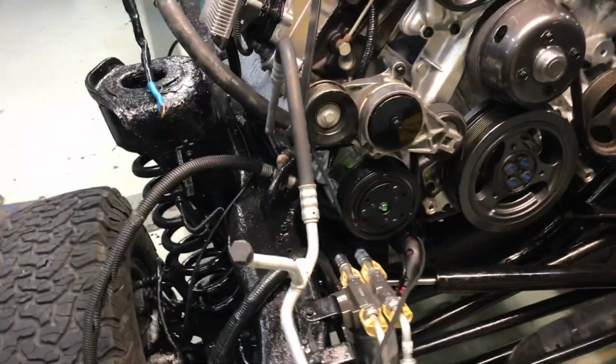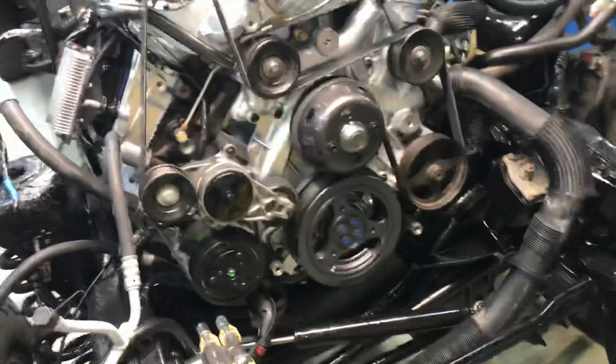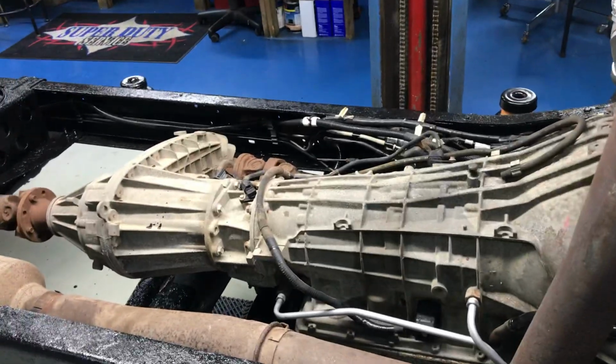We did hang a compressor on it, but we're not doing anything else. What I'll do is I'll unplug the coil, so it won't kick on anyway, because we're not even going to charge it. We're just going to leave it. I might vac it down just to see if it holds vacuum and leave it under vacuum. We kind of spent too much money getting all this done. And it's the middle of wintertime, so at least we got the compressor done. So if we have to come back, drop the accumulator and a condenser, flush out the evaporator core, clean the lines out, it'll be quite a bit simpler job to have AC with that compressor on there. So we went ahead and did it. Spent a little bit of money, but it'll come back in the long run. As long as they don't total the truck or something, god dang it.